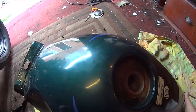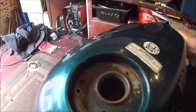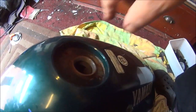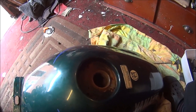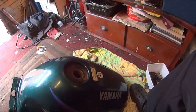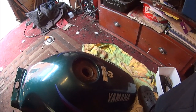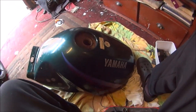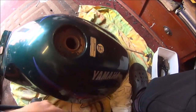This is a different day from what you just saw. What I've done is last night, I gave it a good spray with WD-40 inside, swirled it all around and then left it until today and it was still okay — no rust come back. So all I've got to do now is clean all the WD-40 out with a couple of swishes of petrol and then it should be good to go.